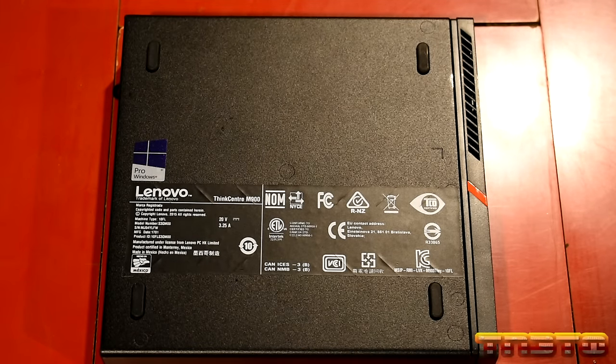Well, okay, guys, I think that's going to wrap it up for this video. We got Windows installed. I'm not going to go through the process of installing all the programs and stuff. I am going to look into the thermal situation, because this unit is running a little bit hot. So I will definitely install HWMonitor and take a look at the CPU temps, and take the heat sink off and reapply thermal compound. But all the drivers are accounted for.